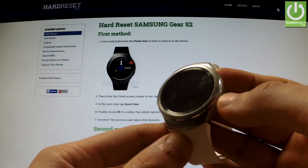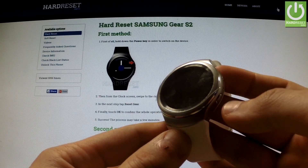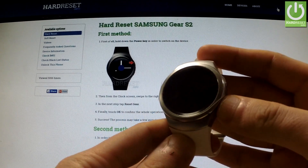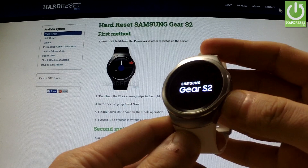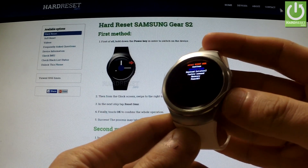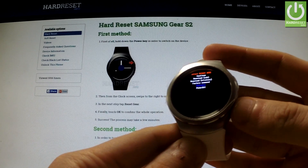While the rebooting screen appears on the device, I should release the power key and keep quickly pressing the power key a couple of times. So let me do it: press and hold the power button, wait until the rebooting screen appears on the device, and now start pressing the power key a couple of times. And here you are in the select reboot mode.